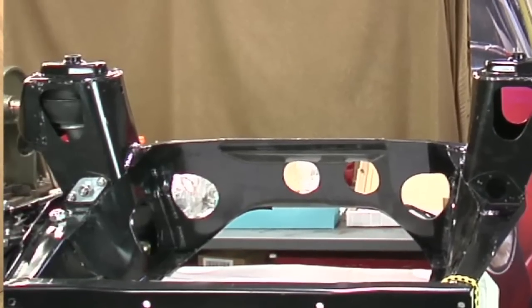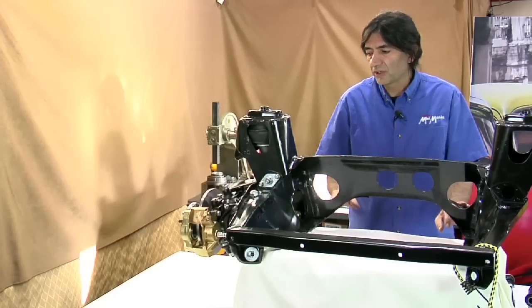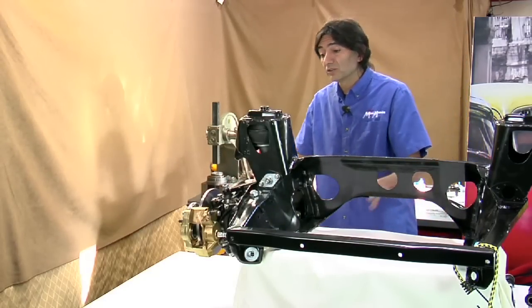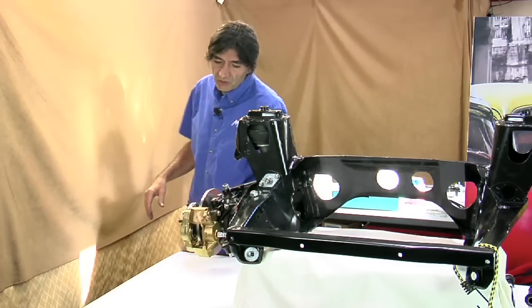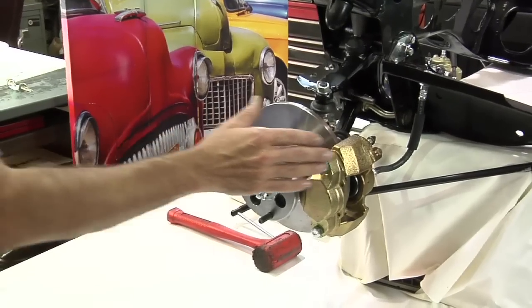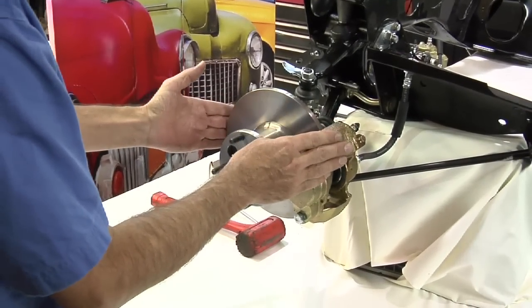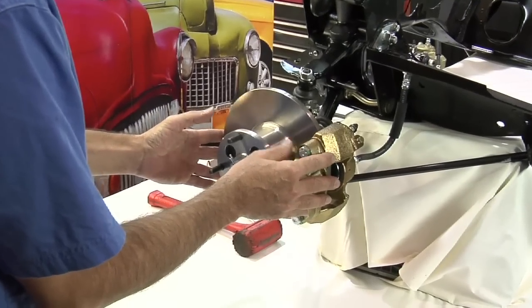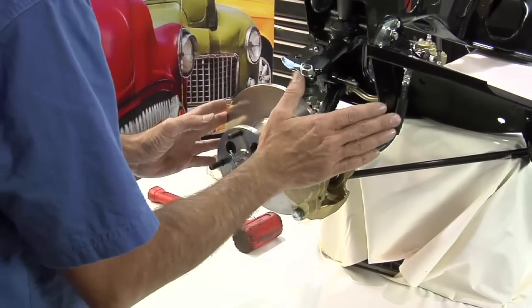'76 to '96 would have been pretty much this basic setup — the right size brakes, all of those. Let's go over to this side here first because this side has been pre-assembled with the stock components. We have the standard known as the 8.4 inch disc brakes. These will only accept 12 or 13 inch wheels. You take a 10 inch wheel — clunk — you're going to hit the caliper body.